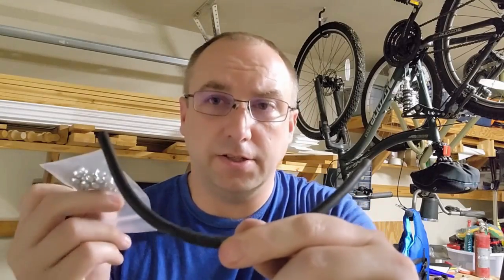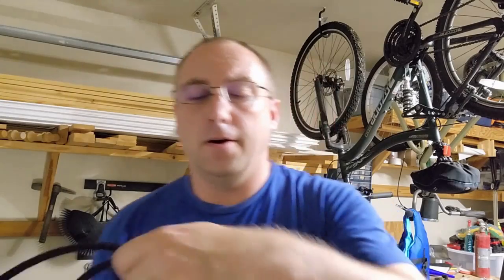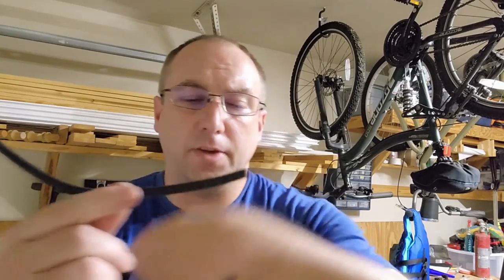These things just didn't work for me — I don't have the tool set to get up there and clamp them on. So, talking with the group again and talking to a couple of guys — Steve, I want to call you out on this one — I was referred to a fuel line made in Germany. It's got all the ratings on it, and I'm going to post a link to all of this in the feed. This line just pushes straight on; it doesn't require any clamps. It's a bit firmer, so it takes a little more effort to get on there, but it's actually a really good line. I've replaced two of them now with this. I also replaced a couple with the Dormans, but they still leaked a little bit, so I know for a fact those things don't stay on. I've made a couple out of this hose and they appear to be holding pretty good.